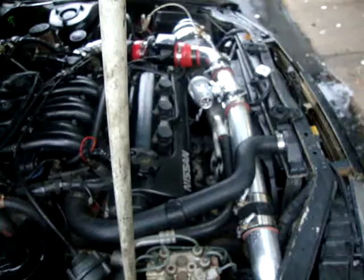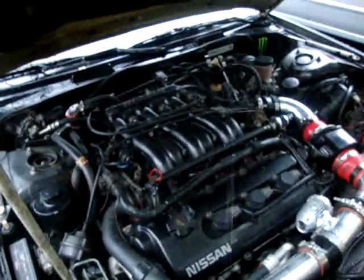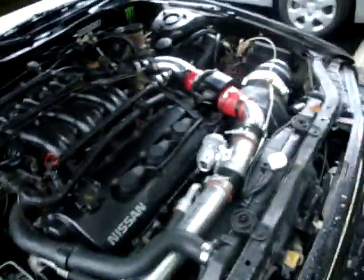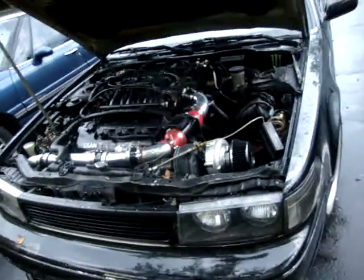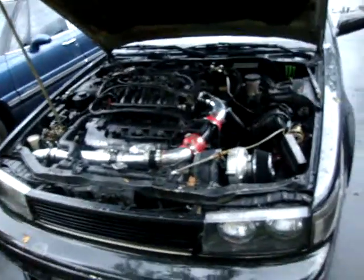You want to wrap your downpipe for sure. I got a three-inch exhaust all the way to the back. There's a website called MES — maduroexhaustsystem.com — they're from Miami, Florida, and they sell all the piping already measured, with bends and everything. Pretty much all you have to do is take the piping to an exhaust shop or do it yourself; it comes with clamps and everything so it's pretty easy and not that expensive.